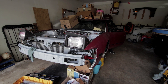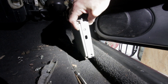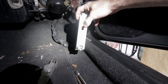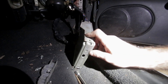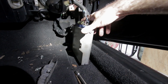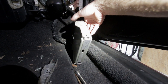Maybe this will be helpful to someone. Right here you can see there's a little knob that says 'self-diagnosis mode select' — what I did was turn that into self-diagnosis mode. There's also a little red LED right here. When I turn the key, this red LED does nothing. According to the forum, I unplugged it and replugged it to make sure my connections were good. I think everything is plugged in, but I believe there's no power to the ECU — same problem the guy on the forum was having. I'm going to see if I can find a relay or a fuse.